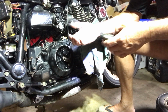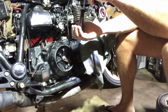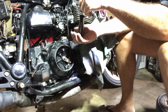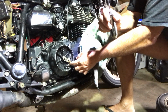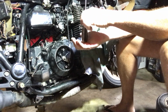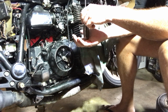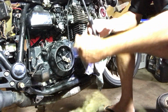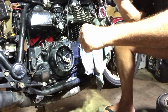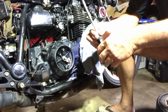and they sit in pockets, and coming out of the pocket, they come up a ramp. So if you've got it adjusted right, that's nice and firm. Your ball bearing is sitting in the bottom of the ramp, so as soon as you start moving, it starts pushing. So by the time you get it around to here, where your clutch lever is hard against your handlebar, your spring pack is way loose and doing what it's supposed to do.